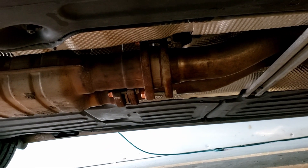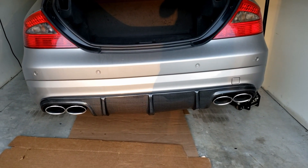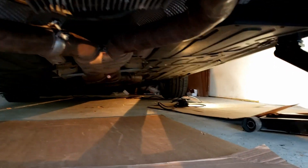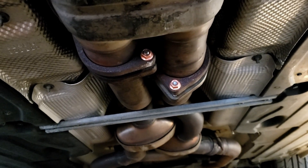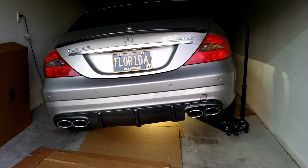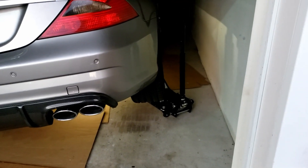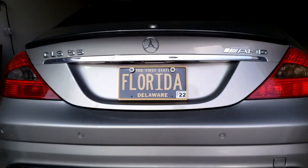The four brand new bolts and nuts are there, so it's time to install the left portion of the exhaust. Both portions are now in place — nothing is tightened yet. I still have to tighten these two flanges, this clamp, and the two nuts and bolts on the driver's side. I have to jack the car from the left because it's very difficult to access those two bolts when the car is jacked on the right. But everything else is already tightened.